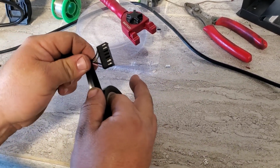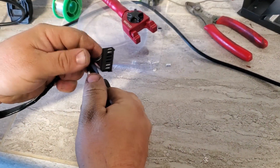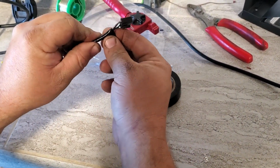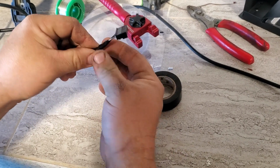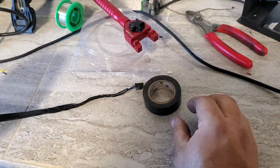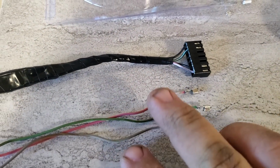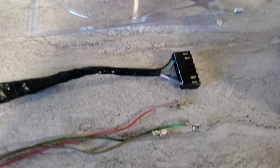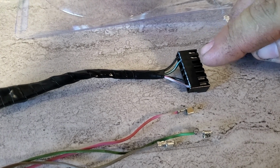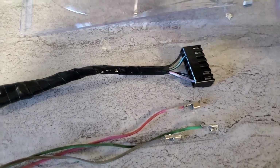When you're doing your electrical tape, get a good tight wrap, and then for the remainder, wrap it loose, and that'll prevent it from peeling back as easy. Okay. I did also de-pin the wires I don't need anymore. You just have to take something small and pointy, push down from the top of the silver tabs, and the wires will pull out from the back.